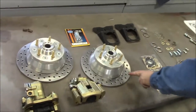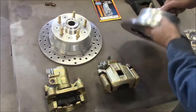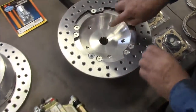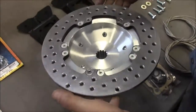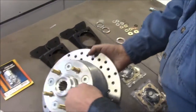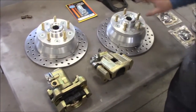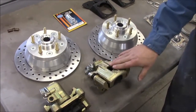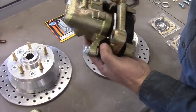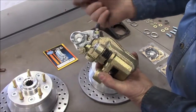We have their billet and cross-drilled braking rotors. On the back you can see they're all nicely machined — it has the spline cut out for the hub. The rotors are really nicely done, and we have a bolt pattern made specific for the aftermarket wheels we're going to be putting on, and they'll match the front. We have calipers that come semi-loaded, so we have the pads, the seals, and this is even set up for parking brakes with the lever and the bleeding screw.